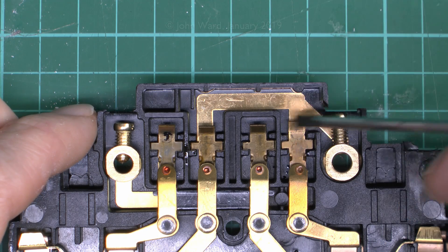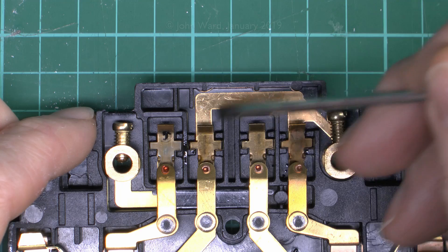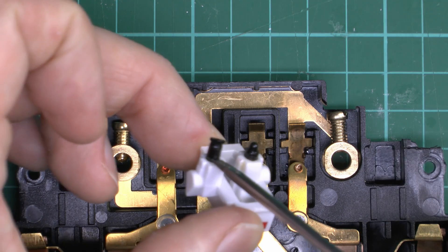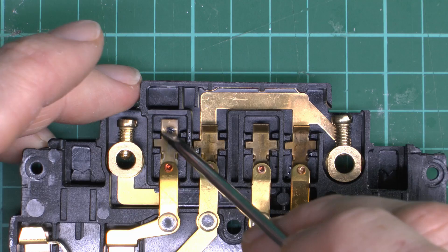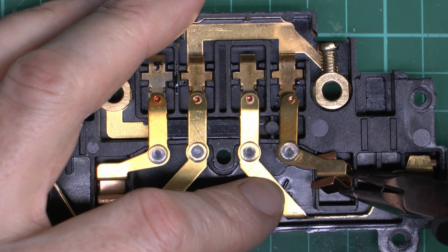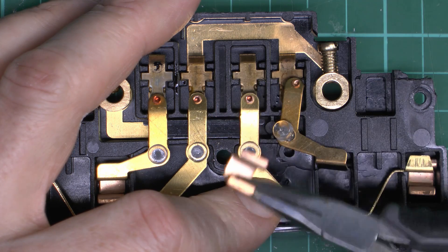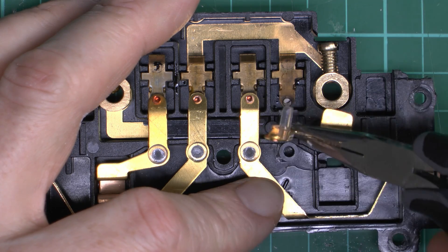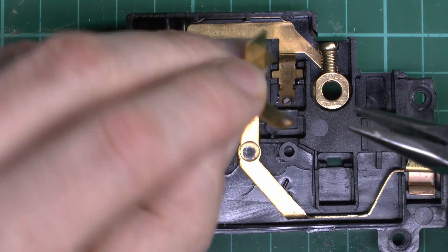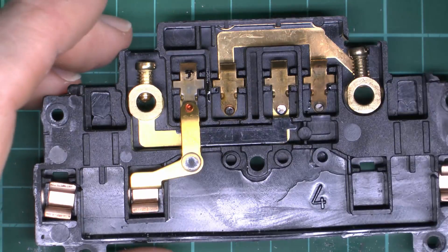So this is where the problem is. In terms of this side not working, it would seem that whatever's happened here has somehow affected the other side, although it's a bit difficult to see quite why, unless this one when it's pressed by this rather obviously flattened thing wasn't actually making correct contact either. As I say both sides were not actually working, so let's just see if we can take these out and see what's happened. Now these are actually separate components — just a U-shaped piece of copper or brass, and the whole thing is held in by press-fit transparent plastic pegs.